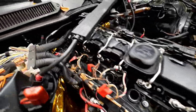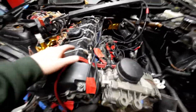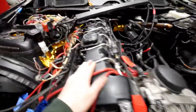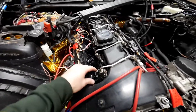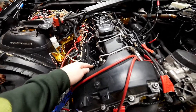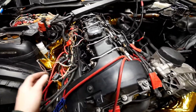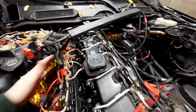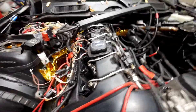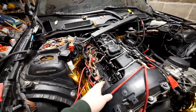All the injectors and the fuel rail lines and everything are on now. Next we are going to take out the old spark plugs that are in here, put the new spark plugs in, and throw the coil packs on, bolt this piece down — and then this whole electrical unit up here is done. It's fairly simple as long as you label everything, like we got here.